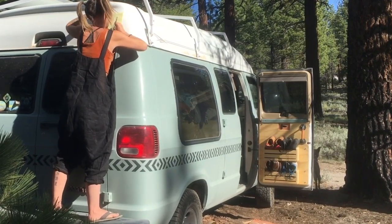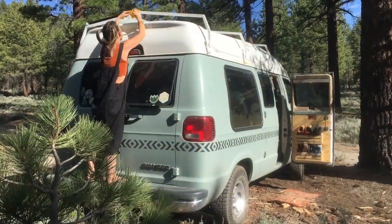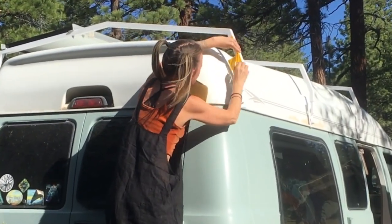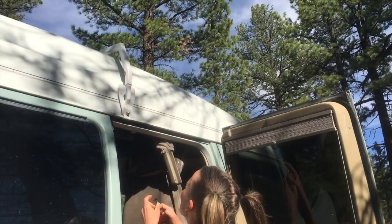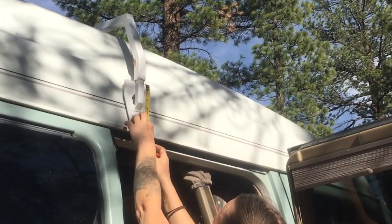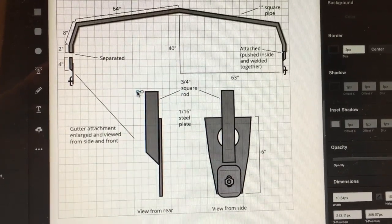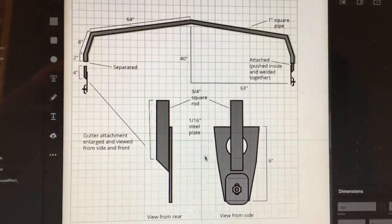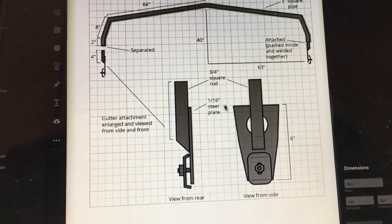So I climbed onto the van and took all the necessary measurements. I invested in a protractor in order to measure where all the angles ended up. And even though I pre-purchased the gutter mounts for my racks — and you can do the same by clicking the link in the description below — I still measured up and made drawings for the mounts in case you or your welder would prefer to make them from scratch. One upside to making them from scratch would be that you can choose to replace the hole in the middle, which is meant for tie-downs, and place two smaller holes on the side of the center bar instead — that's what I would do if I was to remake these today.